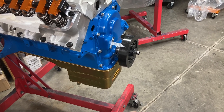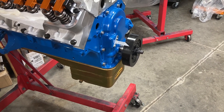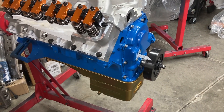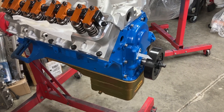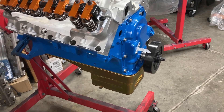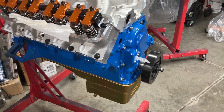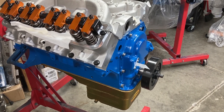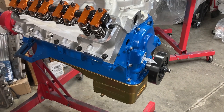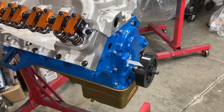The second pro is that dry sump pumps — good ones — pull vacuum on the crankcase. That lets you use thinner rings, gas-ported pistons, that sort of thing. It's very common to pull 15 to 20 inches of vacuum on an engine with a dry sump pump — that's horsepower. And you're also just pulling oil from all over the engine, so it's very, very unlikely that you will have a dip in oil pressure with a dry sump pump.